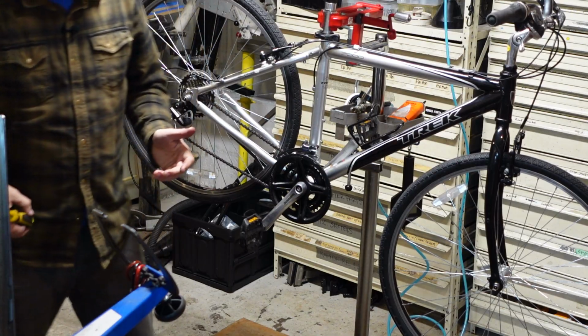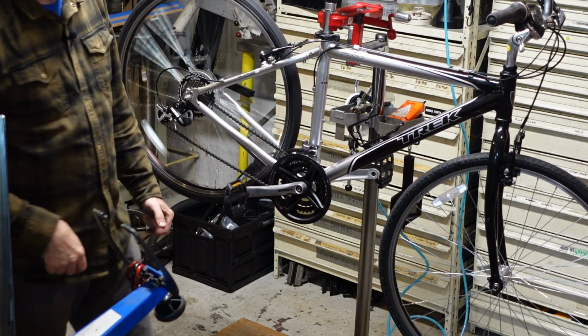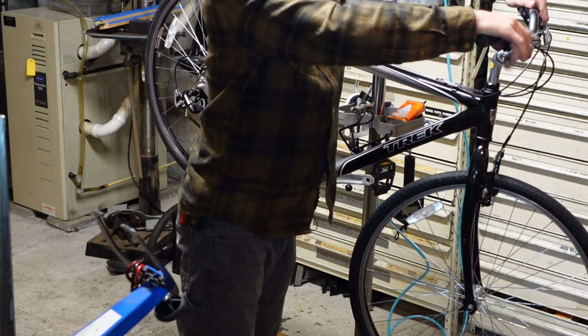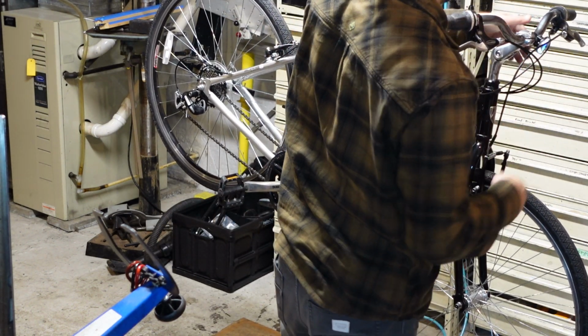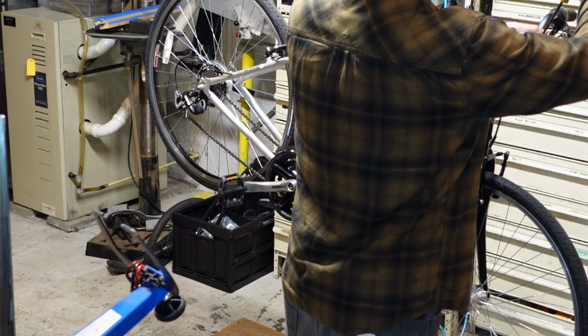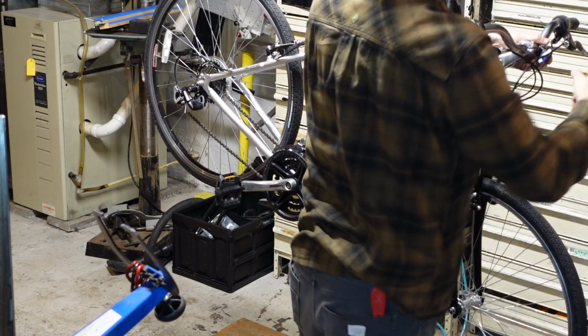That's another thing. Let's say this isn't a very small bike, but maybe the rider has really small hands and you want to turn in the reach adjusters and you need that extra cable. It's nice to be able to use the barrel adjusters to make the brakes looser, not just tighter. You know, part of an on-the-fly setup.